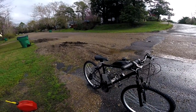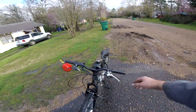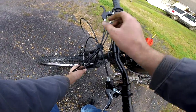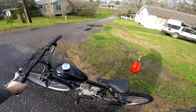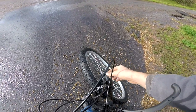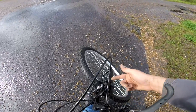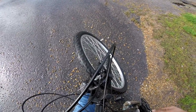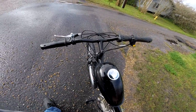Next, we want to move back to the wheels and check to see if they're out of true. I've never actually purchased a bike from a big box store with wheels that were perfectly trued, though I have seen some that are pretty close. You want to make sure that the wheel is not really tweaked out of alignment. If possible, go ahead and reclamp the brakes together to use as a point of reference. You can use your finger, a pencil, a pen, or a screwdriver held against the frame to check how far out of true the wheel is. Spin the wheel and see how it moves from left to right — wobbling from side to side. It's normal for these bikes to have a little wobbling, but if one bends quite severely, you'll want to consider skipping that frame or working on it with spoke truing tools.